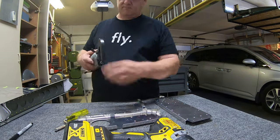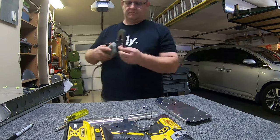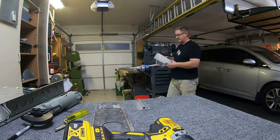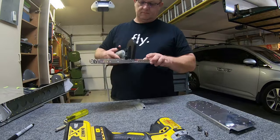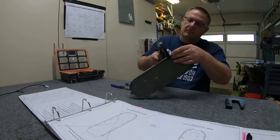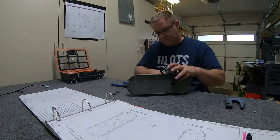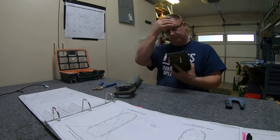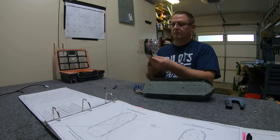That very back part of the aft fuselage is also what holds your rear tie-down. Since I have the 14A, it is the tricycle gear — not the tail dragger — so the back of the aft fuselage doesn't have to get cut open and have the wheel assembly attached. All it gets is that piece of aluminum that you screw a tie-down ring to. I didn't show me painting those — everywhere that I primed stuff I cut that section out just to speed the videos up. If you don't know how to prime a part, check out some of my other videos.